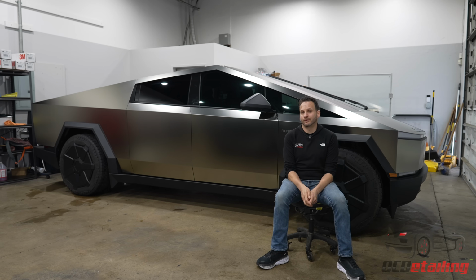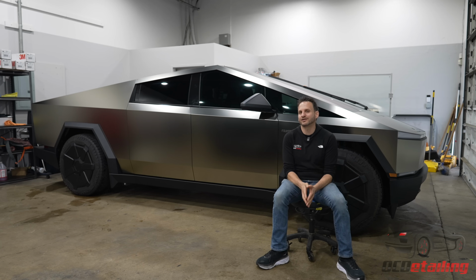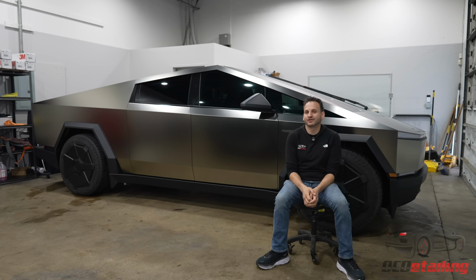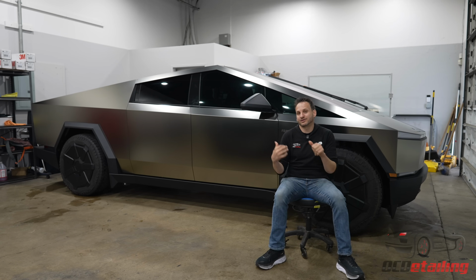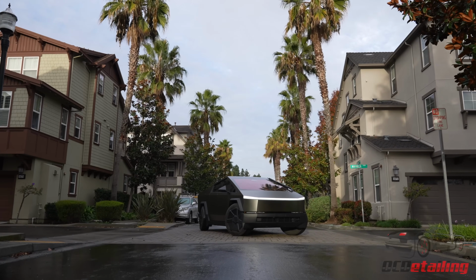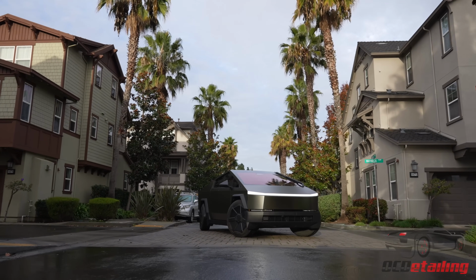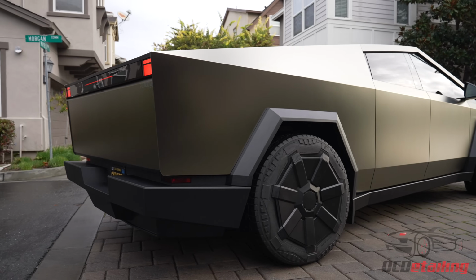You're going to be able to do that with a vinyl wrap, which is a color change that has lots and lots of options out there, but it's literally just a color change film, and usually the lifespan on that film with the best care is about 3 years. Most of the time we're seeing about 1.5 to 2 years, and you're going to want to think about replacing it. The other option you have is what Stek, somebody who was a huge innovator, came out with, which are these colored PPFs. So this one particularly behind me was revolutionary. Like, nobody's ever made a chrome PPF before until Stek did it.